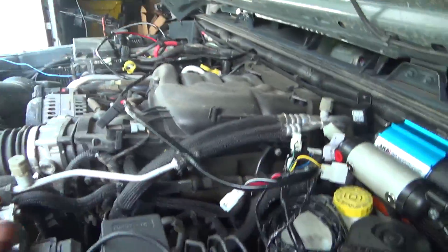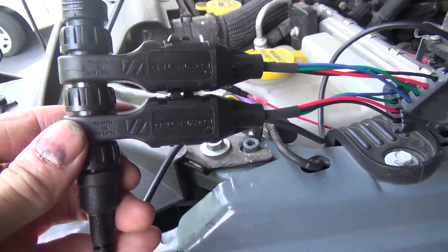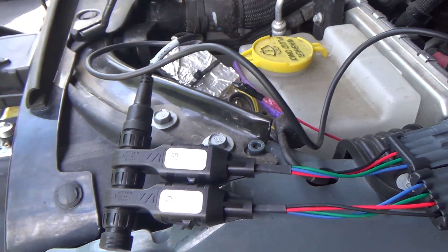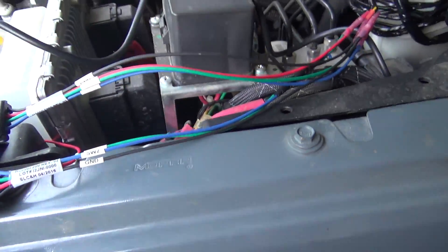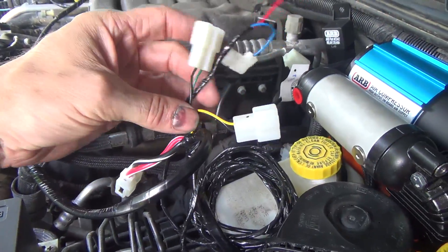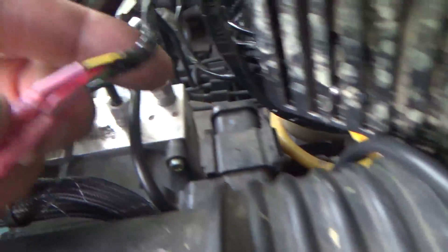I got my wiring all done. I haven't tied it up yet, but I got it figured out, which was the hard part. The way I'm going to power the lockers and the air compressor is through my Superchips Trail Dash 2 using these EAS accessory switches. This goes through the firewall to the Superchips, and then out of here I can control two switches per module. You can stack three modules to have six switches total — I've got four switches total, although I'm only using three. I'm not using the factory wiring harness from ARB, just the part that connects to the essential stuff, the one that goes to the battery. The other one is a big rat's nest for the switches, so I'm not using that one at all.